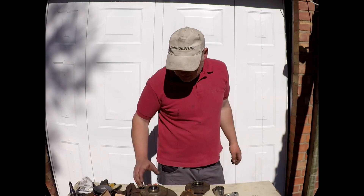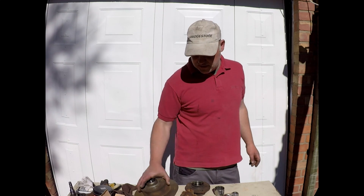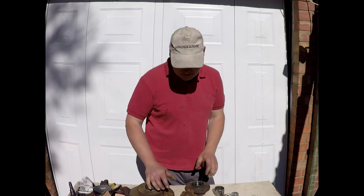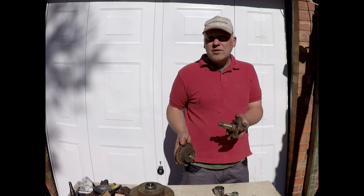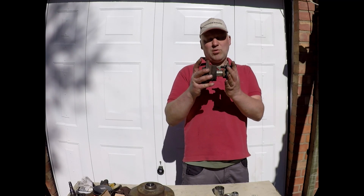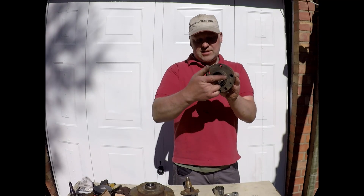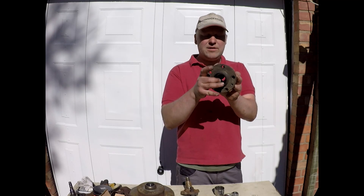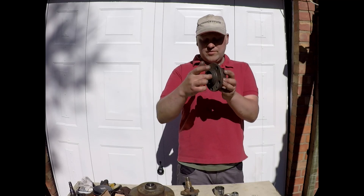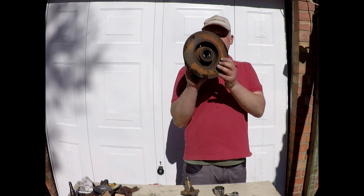The purpose of this video is twofold. One, I'm going to go from four stud to five stud, and whether I should keep using the taper roller bearings or do the Lupo style conversion, which a lot of people bang on about as being pretty much a bolt-up and fit. This is actually Mark 4, not Lupo. The difference is that's a solid fitted hub and bearing together — a roller ball conversion rather than tapered.